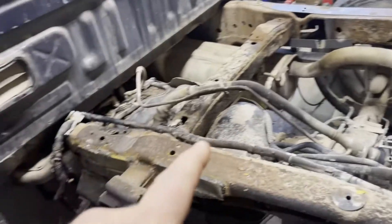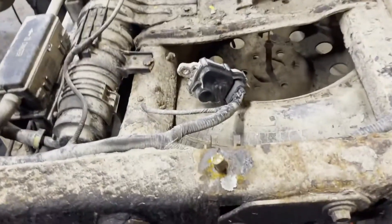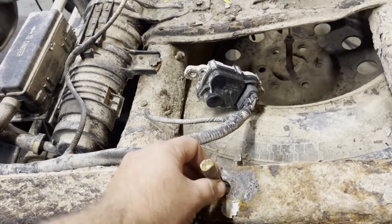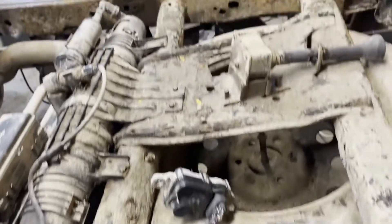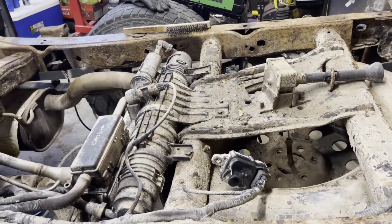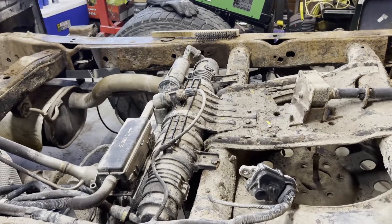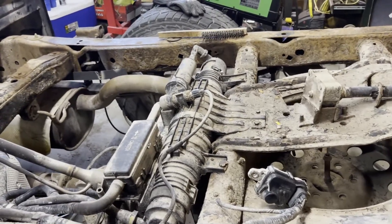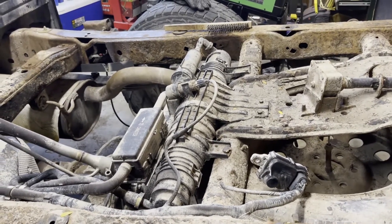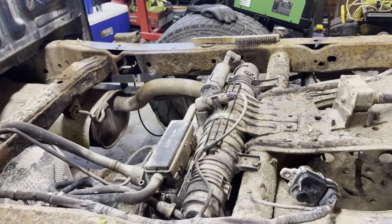I'll go over what it takes to get the bed off this truck. This is a 2004 — the other video I found was out of a 2006 which is really similar. You will have six bolts in the bed. I got one of them out intact, I broke one off, and the rest I welded a half-inch drive extension to the top of each one and had to break them out with breaker bars. They came out intact, but it takes a T50 Plus which is a plus-size bit — I couldn't find one in town. The only thing I had was a regular T50 and that's too small, so I broke one immediately and had to go the route of welding on there. I have a whole new set of bolts coming.